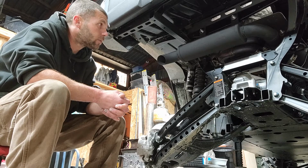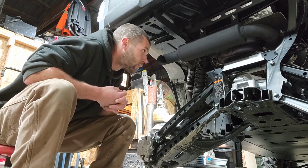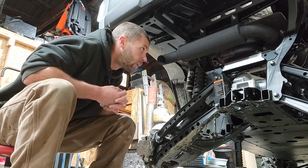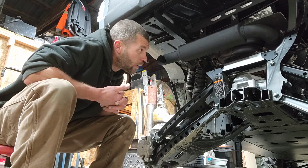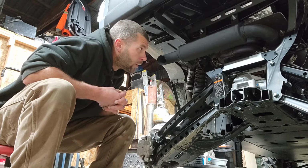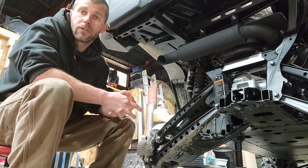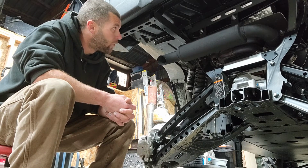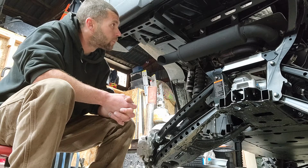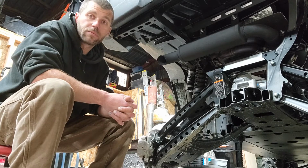The hardware for the flange is just like some 5-inch long or 6-inch long bolt. I used the factory spring, backed up with a couple of washers, a brass bushing to center the spring on the flange, and a lock nut or a lock washer on the back of the nut to make sure it doesn't back off. Other than that, no major tools needed. Really simple, to be honest.